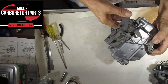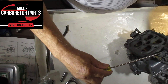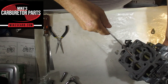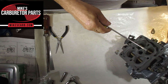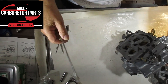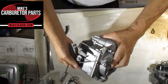Make sure your fast idle is on the low part of the cam. The idle screw actually opens up the throttle valve slightly — the more you turn it in, the more the throttle valve opens and the faster the idle is going to be. You want to set the RPM at whatever the manufacturer says, 500 or 600 RPM, with the engine warmed up and choke open.